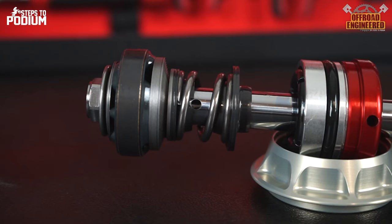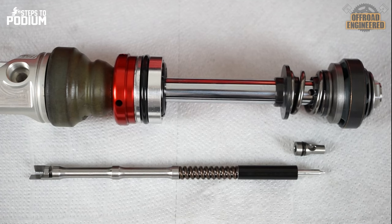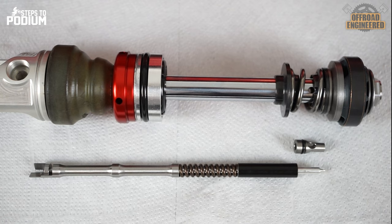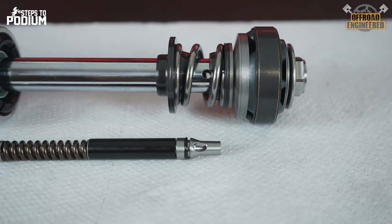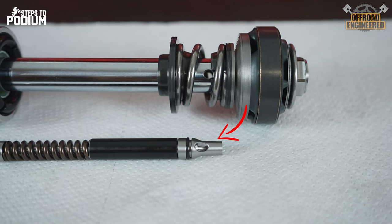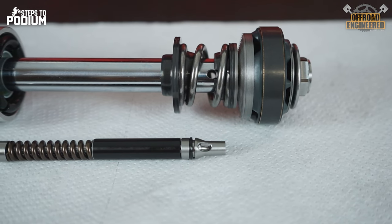Just kidding — it's far more simple than it seems. Let's take a look inside. The SuperTrax system consists of an adjustable oil flow restrictor on the low-speed orifice that will open only when a certain oil pressure is reached. This restrictor is essentially a sleeve with holes that is preloaded by a spring, which in turn is connected to the TXN adjuster.